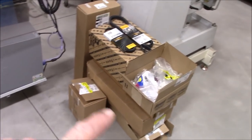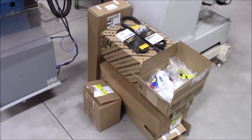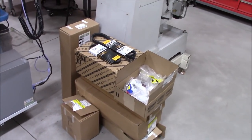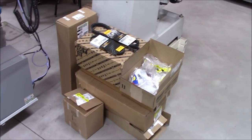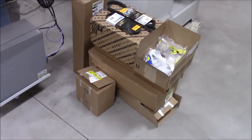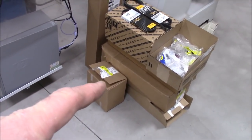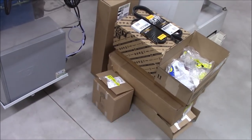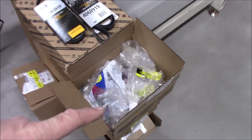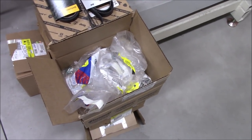Coming around, here's my box of GM parts. I've got exhaust manifolds — the engine came with L94 manifolds, but I found out they hit the frame. So I ended up buying 2008 Trailblazer V8 6.0 manifolds because they tuck in and back so I can build my exhaust off of them. I've also got a heavy-duty transmission rubber mount, heat shields for the exhaust manifolds, belts, and a bunch of GM nuts and bolts — I'm even using the correct bell-housing bolts and studs that this engine should have come with.